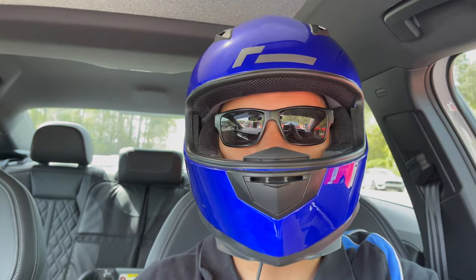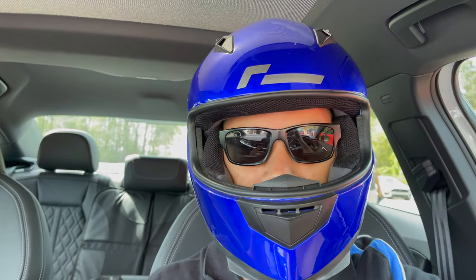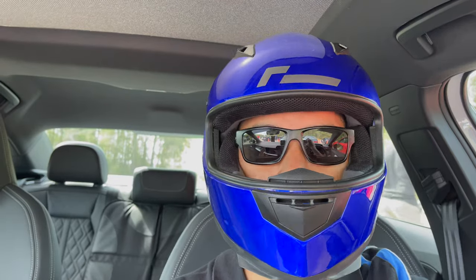I need a little bit more camber up front for sure — I've got it to basically 2.3, I need to get up closer to three. Otherwise the car feels great. The rear end is really holding things down, especially on launch — you can really feel it. Off the launch it's spinning a little bit; the surface here isn't great either, and pairing a bad surface with all-season tires doesn't help. I'm hanging with these guys but I could definitely shave off a lot more time if I could stay tighter in the corners. More camber, stickier tires, and the car's going to be balling.